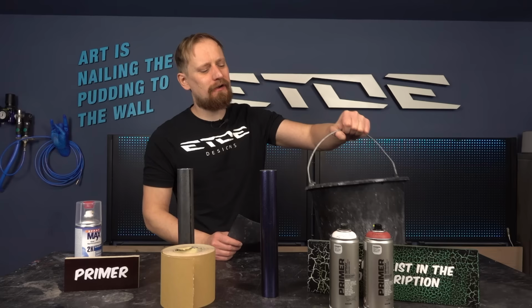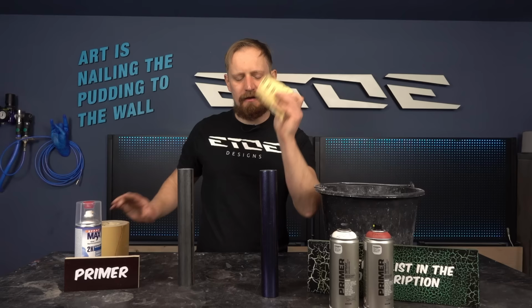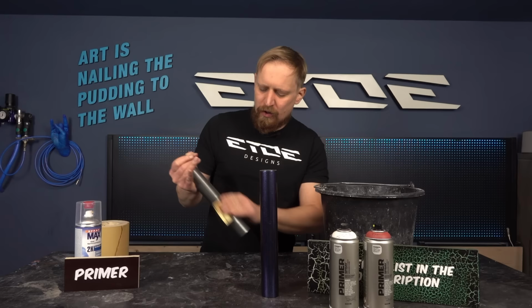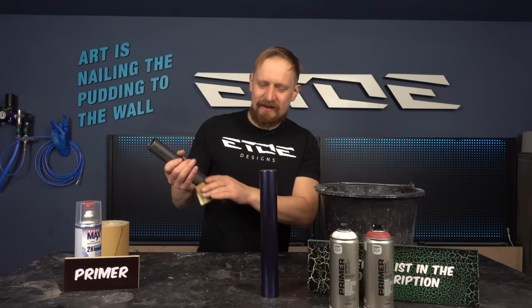And yeah, you have seen me doing this a lot of times, so I will start with this one. I've done it not so often, and it's very simple. You need only a piece of this dry sanding paper, and you can do it by hand. You can remove all the milling and the rust, and when you are done, we can start with the primer in the paint booth or in your garden or your garage or wherever you like to paint your bike.